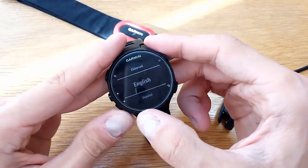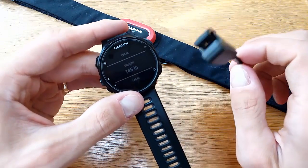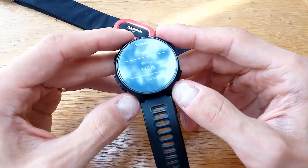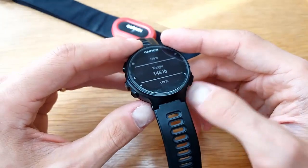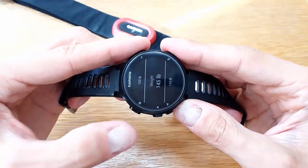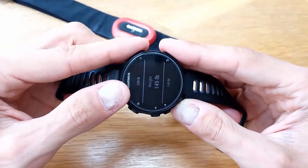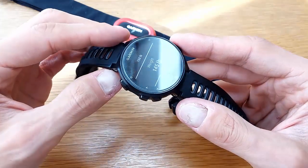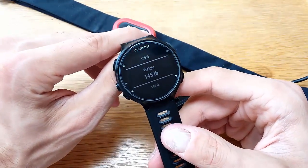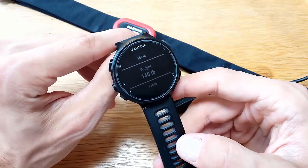Now we have the original screen — everything is wiped completely. So that's it guys, really three things: first, try to charge it if it's totally dead; if it's glitching, try a soft reset by powering it off and back on; and if that doesn't work, do the master reset by holding the selection and return buttons plus the power button when the watch is off, then press the power button until you see the Garmin logo while still holding those two buttons — you should be welcomed with an intro screen for language selection. Let me know if those steps helped, any questions or comments down below. I'd appreciate a subscribe — thanks for watching and I'll see you in the next one.